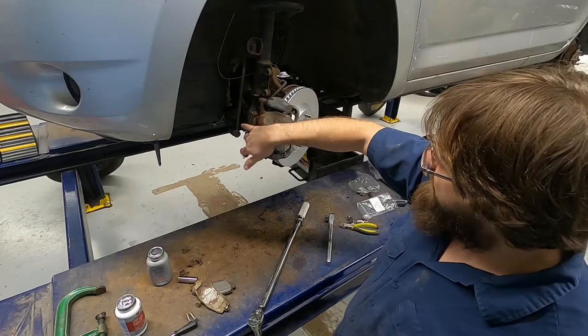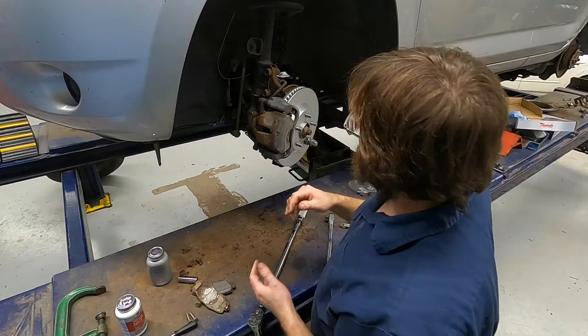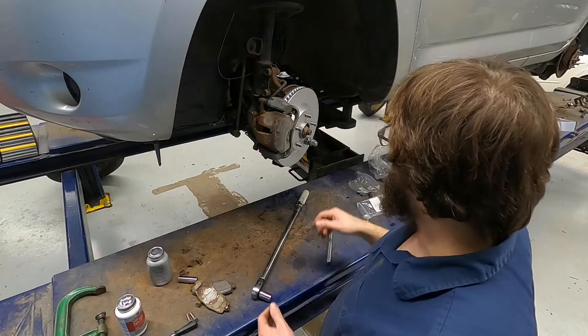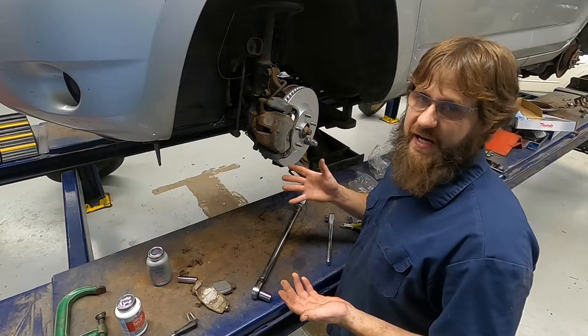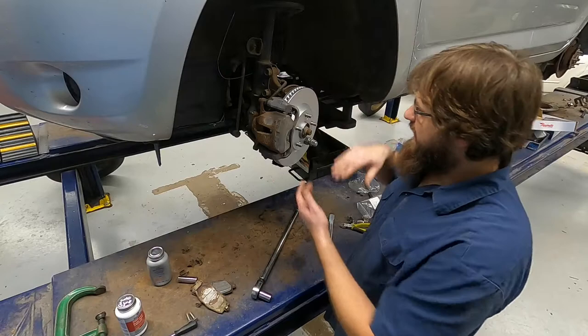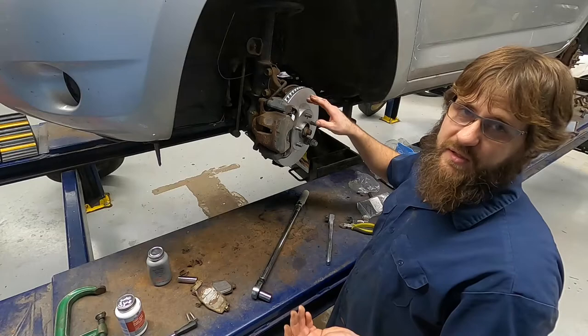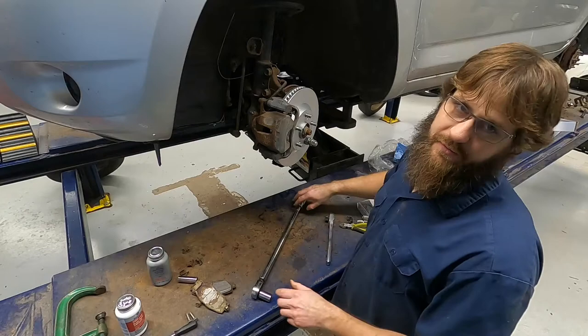I'm not going to finish this one completely right now because I can still do this last piece without torquing it all down — I'll do that later, but I'm not going to finish it on video. We'll torque these small bolts — they're usually pretty light — and finish putting our tire on, and then this wheel is done. That is the way I usually do disc brakes. This bracket stuff, you can do that just about every year where I'm at — if not every two years, it's totally necessary. If you do that service, your brakes last a lot longer. Granted, we still have Chinese garbage metal in the rotors, so they're just going to rust out. And remember, always zero your torque wrenches. Hit subscribe, like, share — thanks for watching, and I'll see you later.